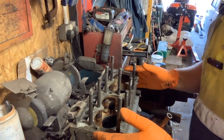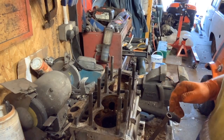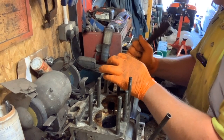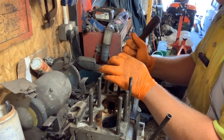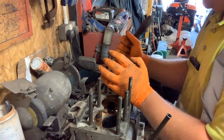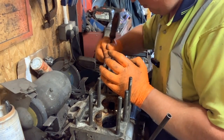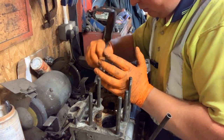What I want to do is get this engine half built so I can get it back into the engine cradle for ease of working on it. So I've got a gasket scraper first. Before I do anything, I'm just going to go over the cylinder head and give it a quick scrape — make sure it's as clean as I can get it. Obviously you don't want to use anything that's going to dig in and damage the aluminium; this is the right tool for scraping gaskets. As you can see, there's just a residue coming off it.